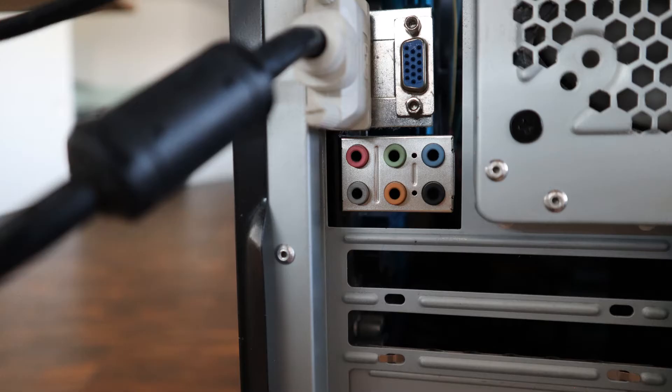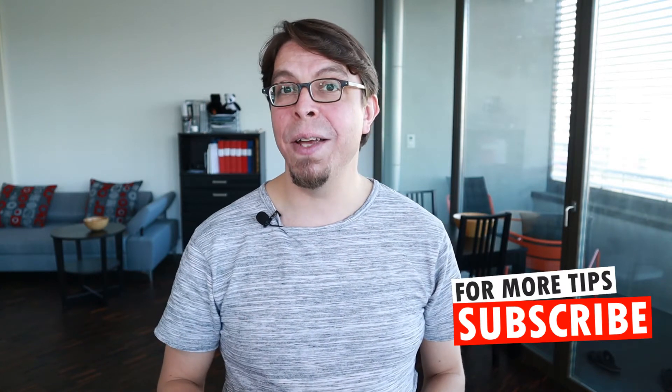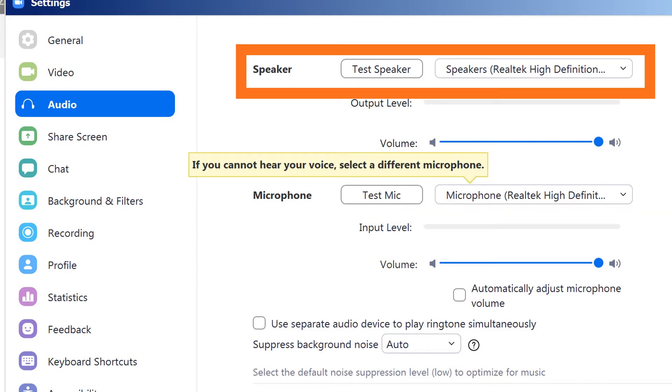When I connect the microphone to my desktop PC, I'm going to use the pink microphone input jack with the switch in camera mode, which means the microphone is working as a traditional 3.5mm microphone. On the PC, I have a separate jack for the headphones, so for sound out I can use any device I want — for example, headphones or the speaker system in my PC. This makes it very easy because you have physically separate inputs and outputs. When I go into Zoom to configure these devices, I can choose completely separate devices for sound out and sound in — in this example, the microphone as sound in and my speaker system as sound out.